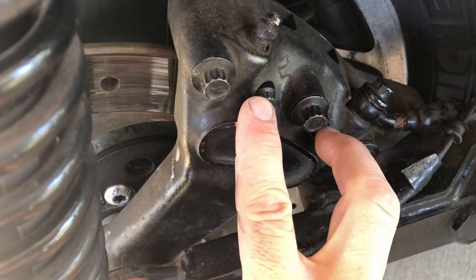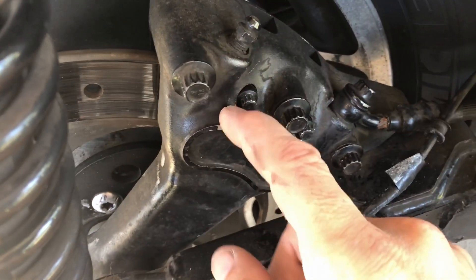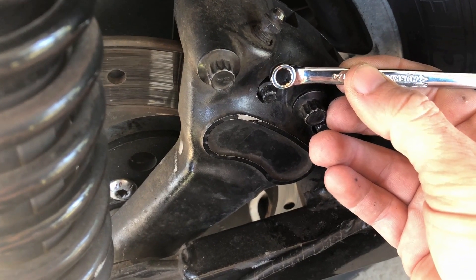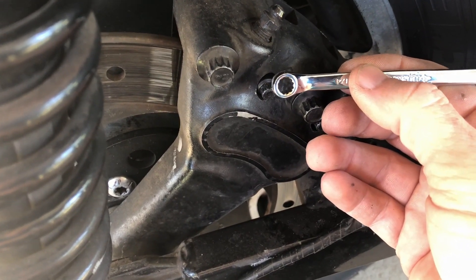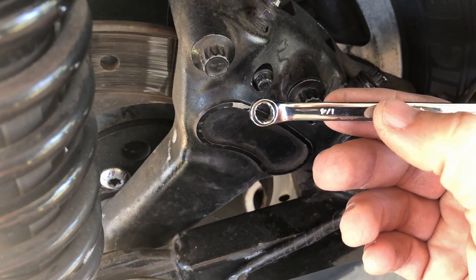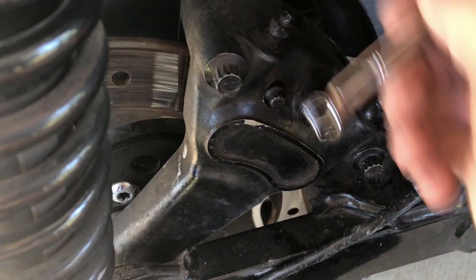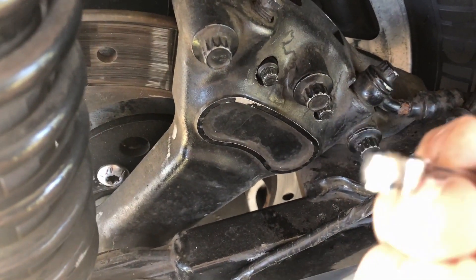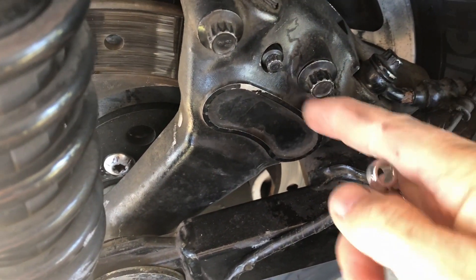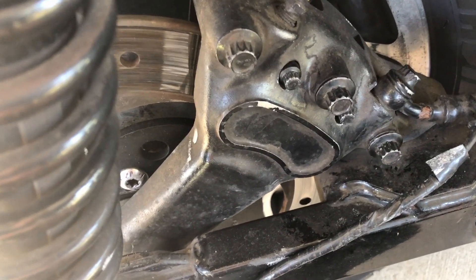Loosen the bolt pins — the pad pins. You're going to need a 12-point socket, quarter of an inch, that will fit in that groove. I went to Home Depot, Lowe's, and Ace Hardware and could not find a socket in stock. You can get one online, but I got a quarter-inch 12-point wrench from Home Depot instead. I did have to shave a little bit off the end with a file so I could get it in that groove — keep that in mind. It's a lot easier to just get the socket.